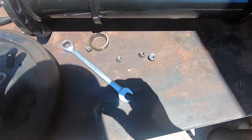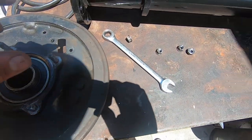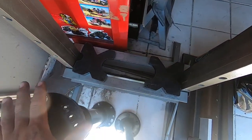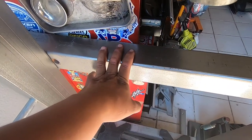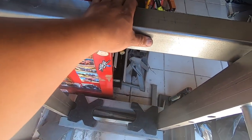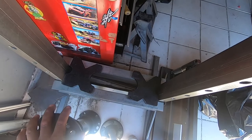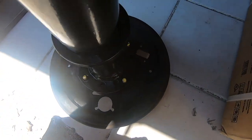We already used this tool on this axle. Another issue we ran into is that this tool doesn't fit in there, so we had to borrow these from our Harbor Freight engine hoist — we put one on this side and one on the other side to open it up enough. This was too big to fit in there; we were thinking of cutting it, but good thing we found these. You can see it has a bunch of different holes — you just gotta find the ones that fit, then throw your nuts on there and turn that out.